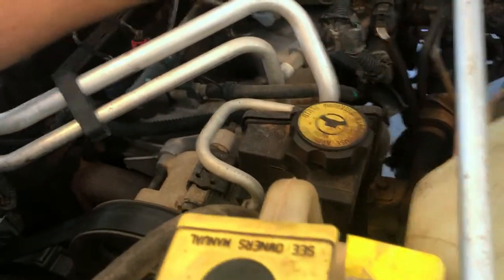The other day, my Jeep was running kind of funny — it was idling weird. Even the throttle was sticking. I'd be driving down the road, go to shift gears, and it would stay up to like 2500 RPMs for three or four seconds and then kind of let off. I checked the usual stuff — throttle cables — and everything seemed to be working fine.